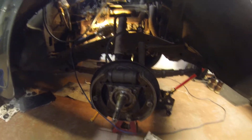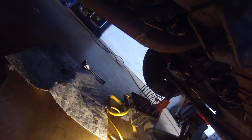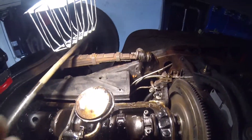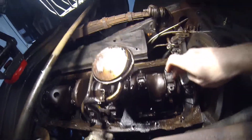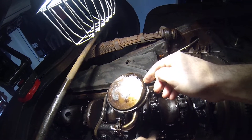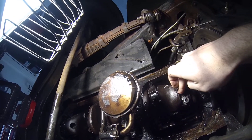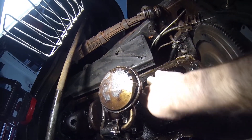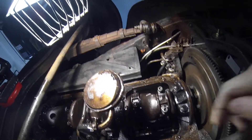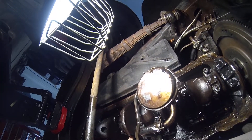I'm going to mount this camera on my head so you can see what I'm doing under here. I'll plug in some extra lights to make it bright. I've decided to go with number six at the back — it's fairly easy to access. Here's my oil pump pickup tube, and there's my oil pump. It runs off the camshaft; you can actually see the camshaft up in there. This is a connecting rod bearing, and this is a main bearing behind it. The main bearings support the center of the crankshaft, and there are four mains on this engine.